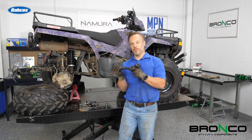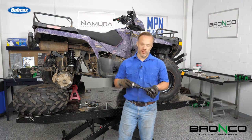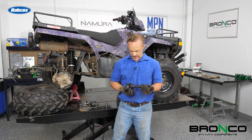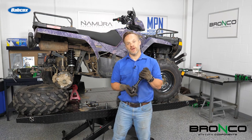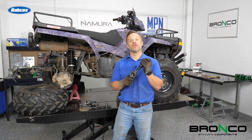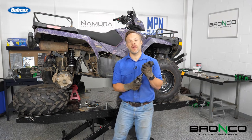U-joints are in, clips are in — time to put it back in the quad. I etched in which one is the front and which one is the back: this one has F, this one has R. Before we do this, there is one key thing to make sure we get long life out of these: make sure that we put the Zerk fitting in, which allows us to put grease in there. Pump it up just until you start to see all four of the boots expand — as soon as you see that, you know it's filled with grease. If you keep going past that point, it can open it up for leakage and allow water and grit to get in.